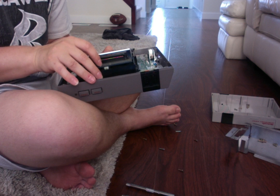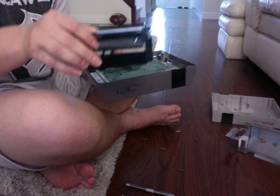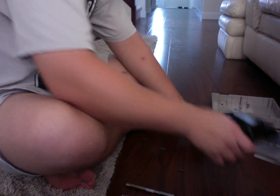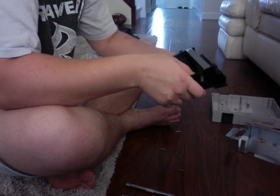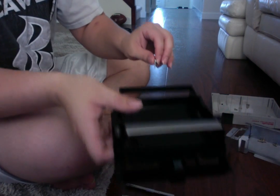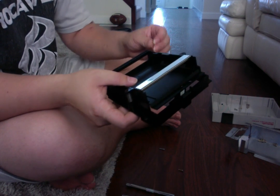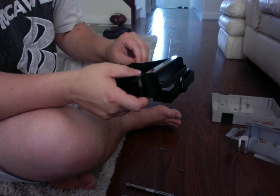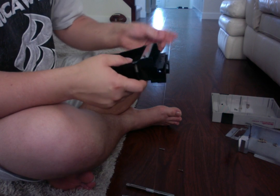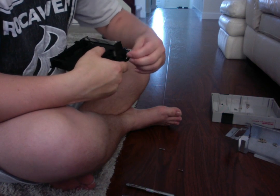So now carefully, without scratching the circuitry, lift it up a bit on an angle and slide it out carefully, and it'll come right out. Again, so we don't lose the screws, we're going to put each screw back together where it originally came from. And always remember that the silver ones, these galvanized steel ones, go in these holes here. So here's the front of the case, right? They go in the second last hole from the front. Okay. All right, so. Dropped a screw.